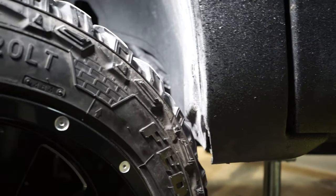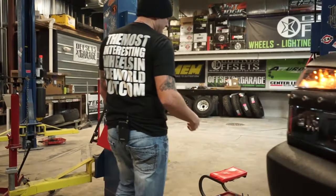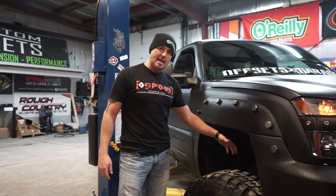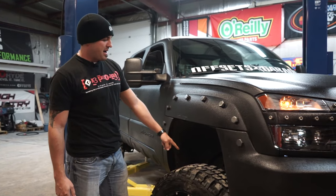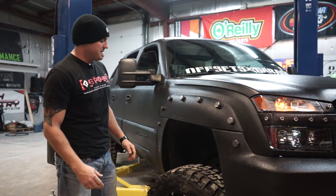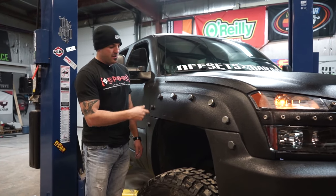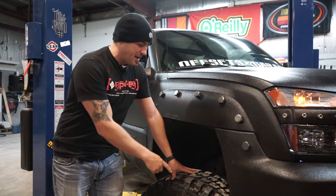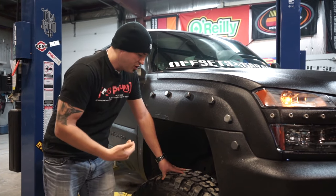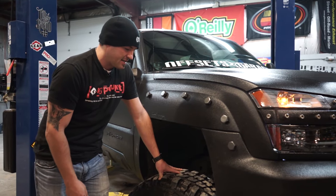Got a good half inch — you could jump small ditches, not the big ones. So when you guys are asking if I add a spacer will it help rubbing: if you're hitting on the inner components, yes. If you go to put that wheel on and you hit the brake caliper, you could add a spacer to get it out of there if you chose too small of a diameter wheel, if it's within reason. Sometimes people use the 3/8 inch spacers to do just that. But if you add a big old two inch spacer, you now need to consider the fitment of basically a two inch wider wheel, because you're pushing that entire wheel out that far, and the geometry of it slams it into that bumper or the back side of it.